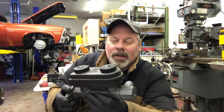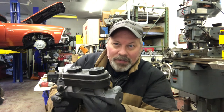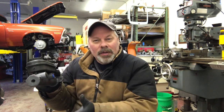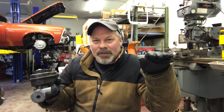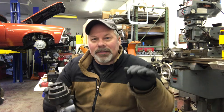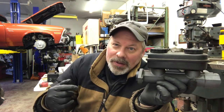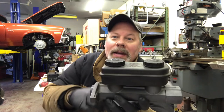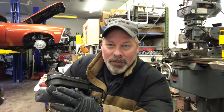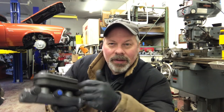Now you're going to put it on the car. Here's a trick that nobody does that I'm aware of — I never see anybody do it. So bench bleed your master, take the old one off the car, and collect the fluid that runs out. The lines, because they're up high in the car — higher than the calipers and rear wheel cylinders — they're not going to leak much fluid and they can sit there a long time. Install your new master. Then, because I'm by myself, I'll slowly stroke the brake pedal down with the lines disconnected and put a stick to hold it all the way down. Then I'll connect my fluid connections with the brake pedal depressed. When I let go, it's going to pull whatever little bit of air exists between the master and the line back up into the master, and you don't have to touch the wheels.